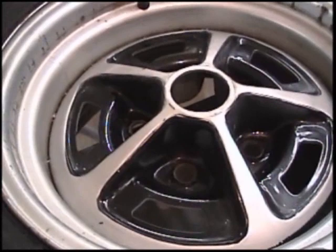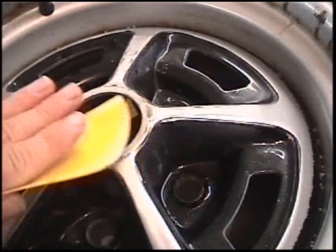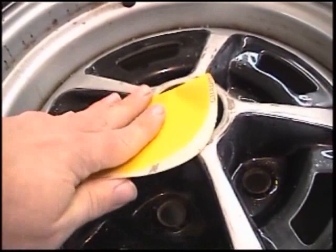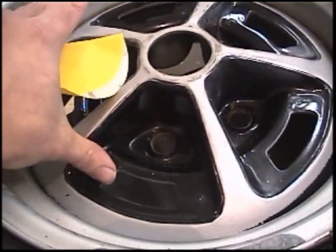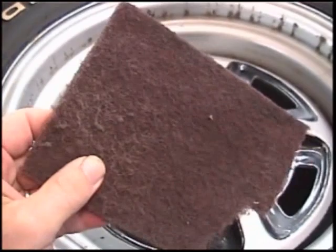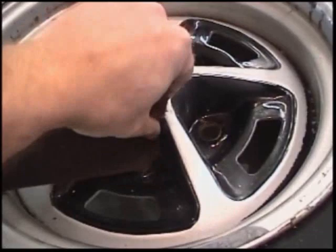After you've got it all wiped down, get some sandpaper — you can use 320 or 180 grit; I'm using 180 here — and you're going to sand this panel down. When you're all done sanding, go back over with some 320, which is a little less coarse. The 180 gets some of the deeper scratches and pits out, then the 320 smooths it all out. Do that with the whole wheel. The inner area is hard to sand — they make a scuffing pad, like a gridded pad, and you can scuff in there to at least get that paint scuffed up so new paint will stick to it.